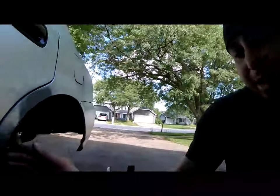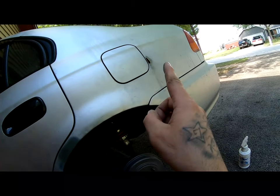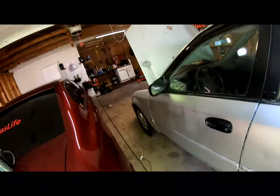So I'm gonna go ahead and finish this side up, tackle the other side, do this little chunk right here, shape everything exactly where we want it, and then I'm gonna upload this video. And on my next video, I might go live and just start sanding everything down and getting everything ready for a primer. So I wanna go ahead and lay a sealer on the whole car. And when I do that, I'm gonna go ahead and sand everything up to 800 grit. And then we'll definitely be ready to lay some paint and pick a color.